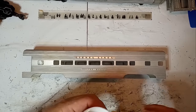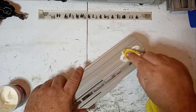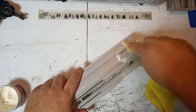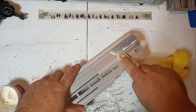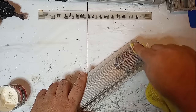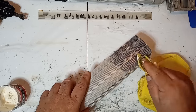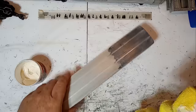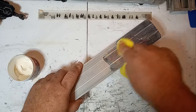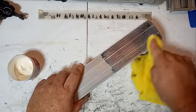Take your clean cloth and dip some polish in — it doesn't take a lot. I like starting on the roof and just start rubbing it in. You want to work it — you see how it's starting to turn black in this corner? That's good, that's what you want. Work it in until it starts turning black; that's pulling the oxide off of the aluminum. Work it in as much as you can, and re-apply as necessary. If it starts getting a little too thin, you can add more. Keep working it in until it starts turning black. One thing you don't want to do: don't leave it on there so long that it dries. Working on a piece this size, that shouldn't be a problem.